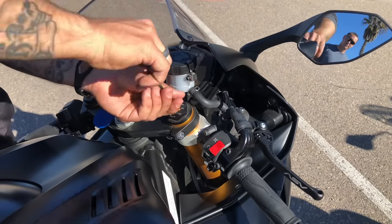So I just showed you both extremes. Now I'm going to start taking the needle out incrementally and repeat the test until it behaves correctly. I'll count clicks this time — I'll take out seven clicks. Do the test: it comes up and settles — is it about half an inch or too much? Hard to tell exactly. So I'll take out a couple more — now at nine clicks. More oil can flow through. What do we expect? More bounce, right? And yes, it's too much now — bouncing around. Good, the experiment matches what I'm teaching.